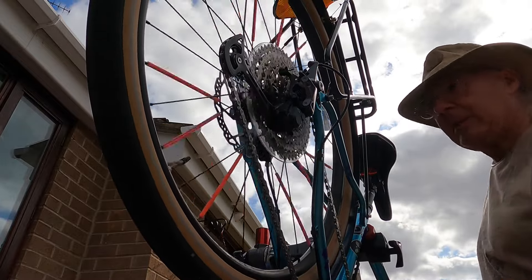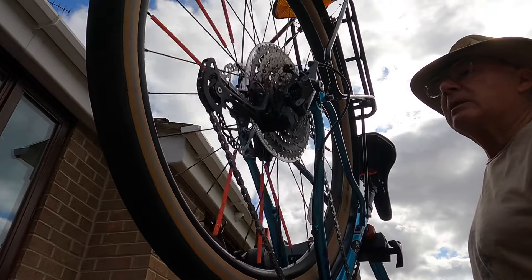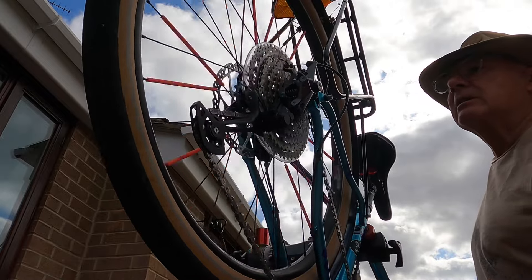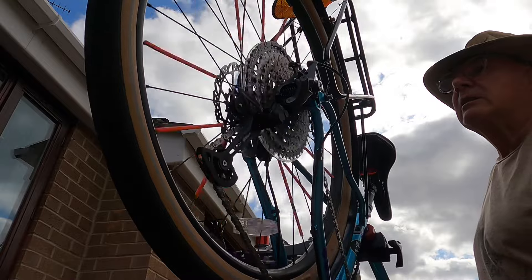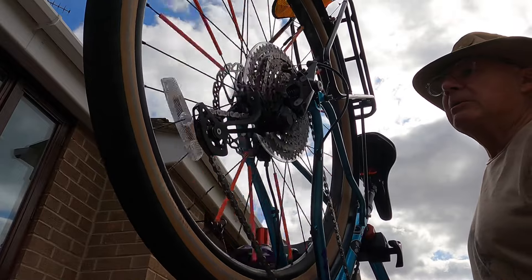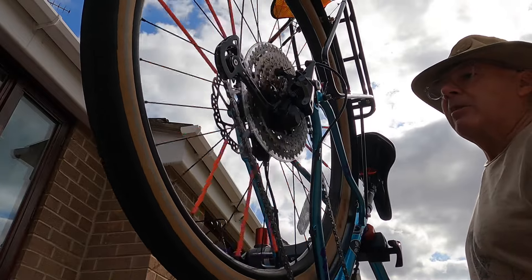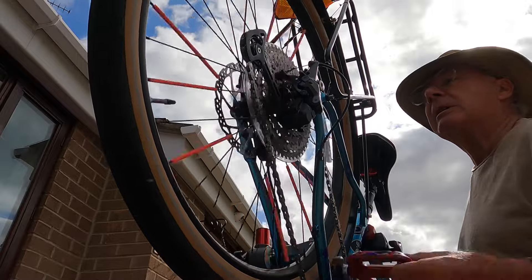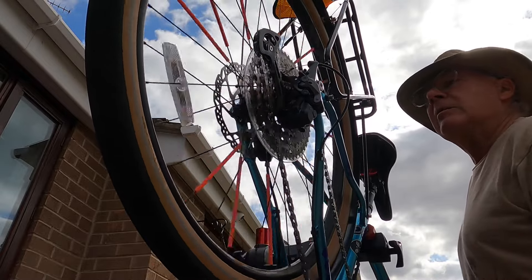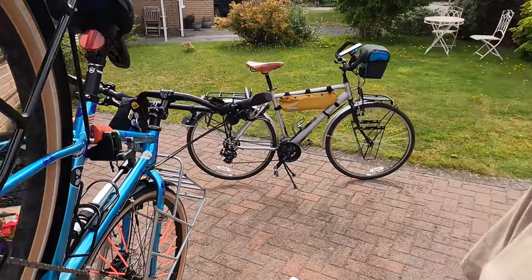It's important that it just clicks through the gears nice and steady, as if you're riding. When you're riding you don't change gear with full weight on the pedals. It did an anomaly then — it went down a couple of gears — so there's definitely fine adjustment to be had. There's still a bit of a wobble on the wheel, but nothing major — that's going to go in the wheel truing stand.